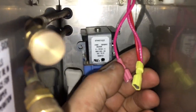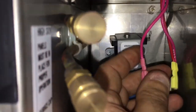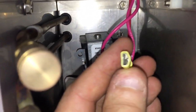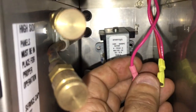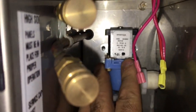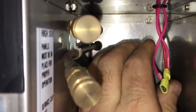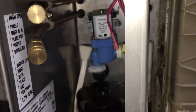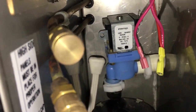Make sure your electrical connections are tight — your stake-ons, your push-ons. This one was a little loose so I snugged it down a bit. Make sure they're in good condition and not going to break or fall apart. Secure the valve and you're good to go. Putting the electrical on last gives you a little room to work. Thanks for watching — click like and subscribe, take care, bye.